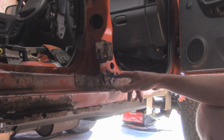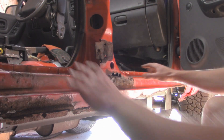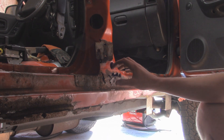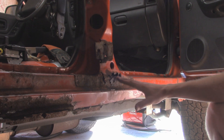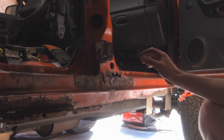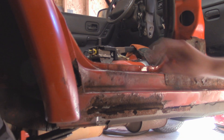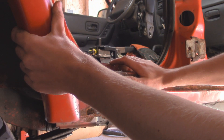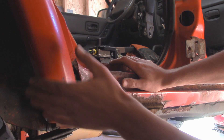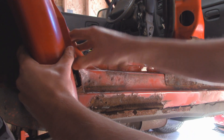I am going to have to do a little bit of repair on this B pillar here because it's pretty bad. I kind of drew out a line with a sharpie roughly where I'm going to cut — basically just this top sheet metal piece that's spot welded to this top of the rocker. I'm going to cut that out and hammer out all of those spot welds and then clean it up, make a new sheet metal piece that I can weld into this and weld directly back over that. I think I might have to make a flange because this is pretty much rotted out here and we need that to weld onto the new rocker. If you guys are following along and don't have as much rust as I do, basically just want to start off by cutting this line right here going all the way to the back. The rust just starts to climb up here — there's some rust up there. And then I got to replace the inner rocker right here where the rear seat bracket is because there's some holes going through there as well.